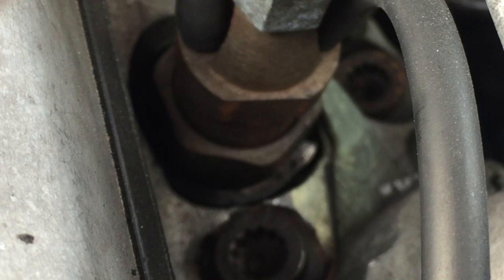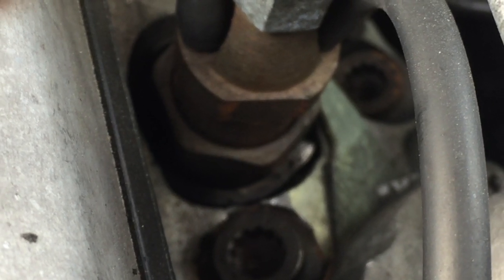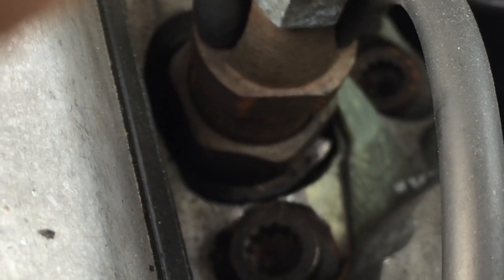Here I'm zoomed in at the fuel injector that's still installed. After your removal, there is a lock nut that has a big slot in it, and that is the one that you need to loosen up. How do you loosen that up? It gets tricky — you need a special tool, and without it you won't be able to get that out.